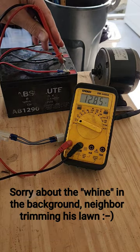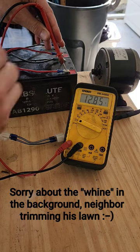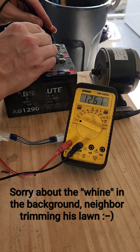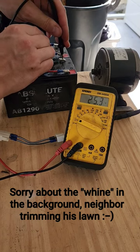Each battery in your system should read 12.5 volts or more to be usable. They are wired in series when they're wired together in your cart to give you 24 volts. This one's reading at 12.85, and this one's reading at 12.64, so we're okay. If we put them together we're actually going to read 25.3 volts.